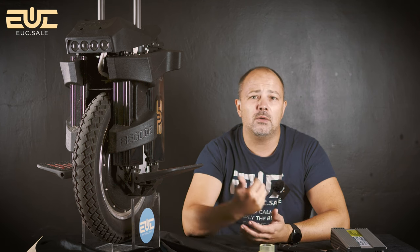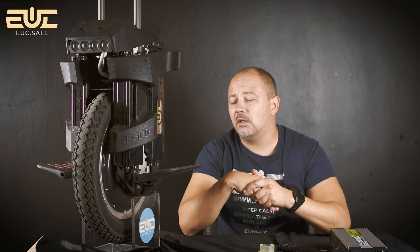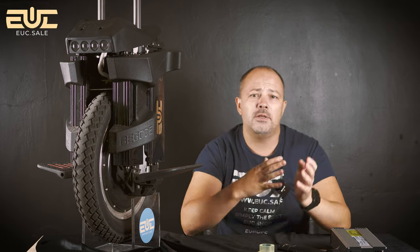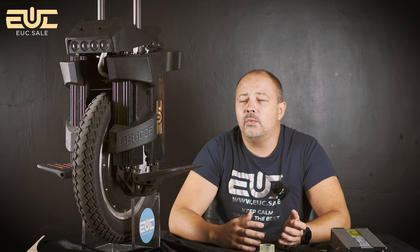But on high speed, I feel that, and returning to what I said, I don't want to go faster than 50, because we have here only 100 volt, I am heavy, and 1800 watt hour batteries, 4 parallels, not so big. I feel that at such speed the motors are losing power and don't want to provide that easy acceleration. So I just don't want to risk playing with that here. This is the off-road and city wheel, but not for extreme riding at high speed. If you try to ride fast up to 60 with that wheel, you will get crashed, you will get a cut-off and so on.